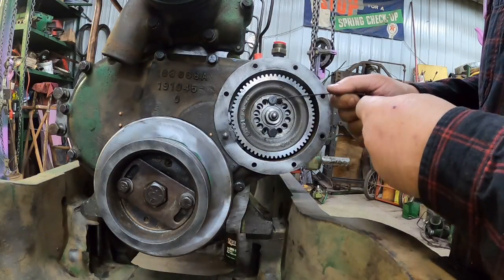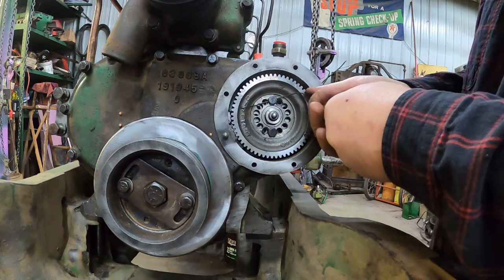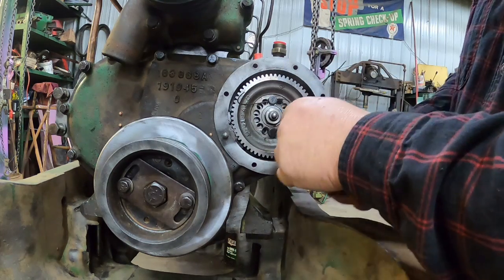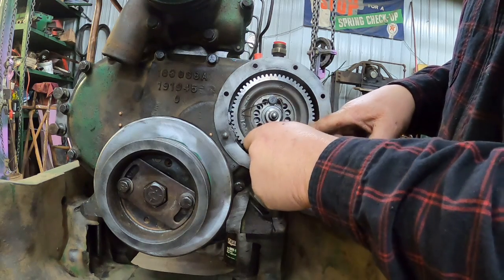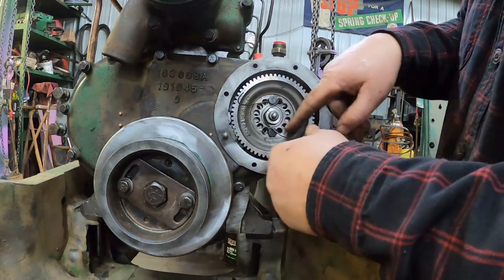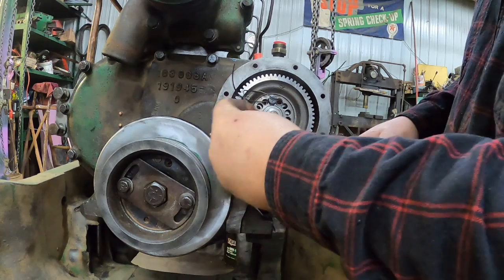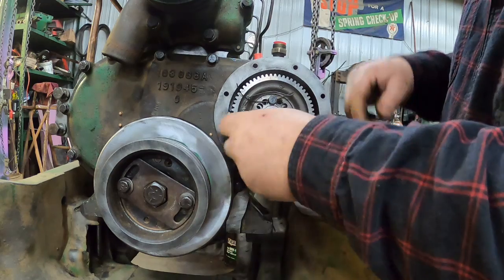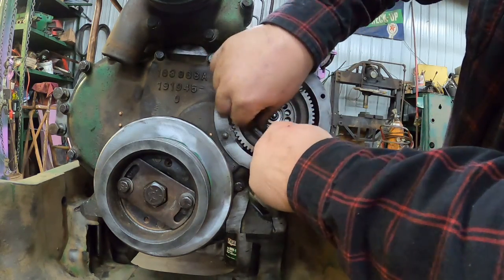Now, don't want to forget our safety wire. Now, if the bolts were to come out, they're going to go like that. So you want this wire to pull down. Let's cross it over here and send it through this bolt. I probably cut it plenty long. Always easier to cut off the excess than it is to put some back on. Granted, it's brand new wire.